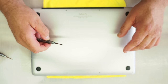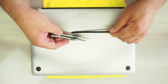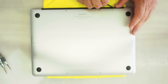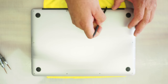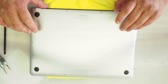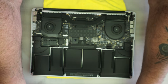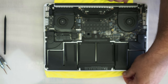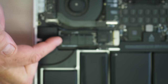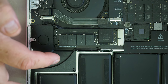I'm laying the MacBook on a piece of terrycloth with the hinge for the screen towards me. Using the plastic tool provided with the star bits I bought off Amazon, I'm just going to pry a little bit on the back and get my fingers under there. There are two little clips inside that'll pop, and once you get it popped open you just gently remove the back of the MacBook Pro and set it out of the way. Now I'm going to zoom in on this chip here — this is Apple's NVMe hard drive.